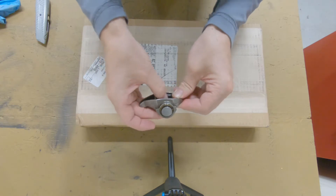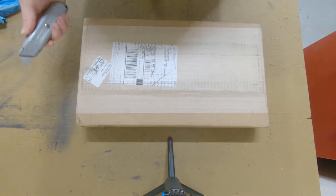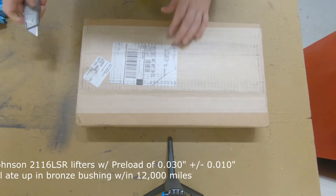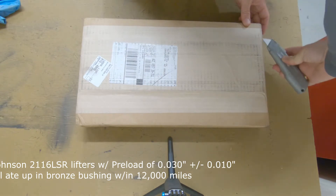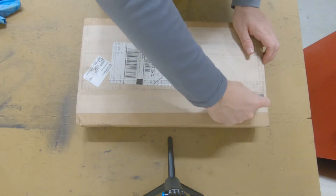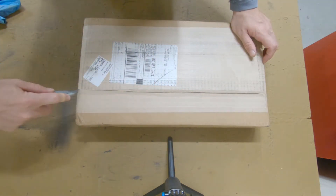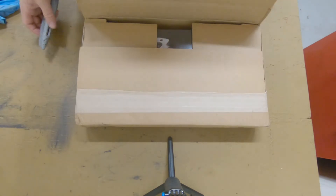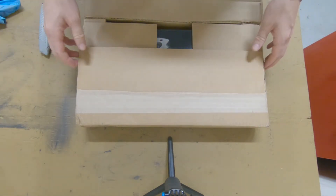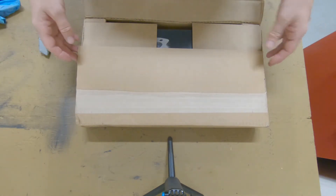So that took my lifters out of spec. I have Johnson 2116 LSR lifters and they require a very tight preload. In light of that, I ordered all new rocker arms. I don't want to have to worry about bronze bushings wearing out or any of that going back into rebuilding. I know there's some kits that last a lot longer and that might not be as big of an issue.